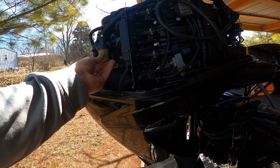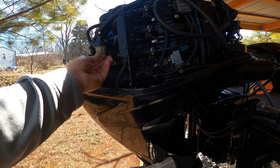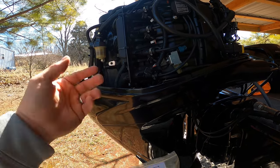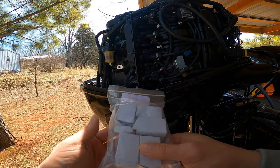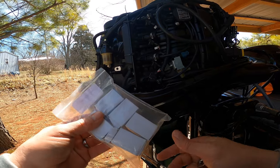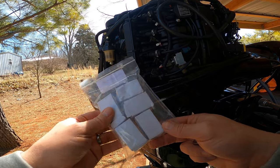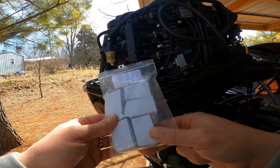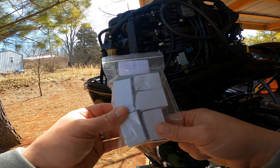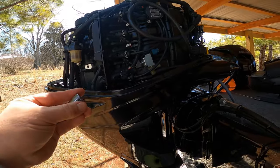As an added bonus — while I had the motor cover off, I noticed I was looking at my fuel filter housing down here and the filter looked pretty dark. I wanted to change that fuel filter. I ordered these off Amazon — there's a pack of like five fuel filters. I'll put the link to the oil kit, the fuel filters, and the tools I used in the description below. You're going to need a 14 millimeter socket to take this off.